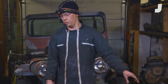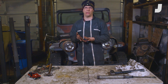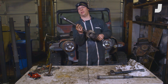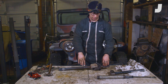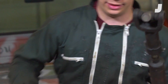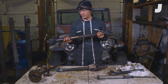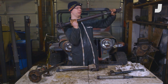Now we're going to move on to U-joints. Those CV style axles you see on all sorts of different kinds of passenger cars, but on heavier duty stuff, especially things with solid axles, you'll see U-joint axle shafts like this one here. It just has a single pivot and that's because it sits inside of an axle. That axle moves up and down, so all this has to do is comply when you turn your wheel left and right. It receives power from a drive shaft, and when that axle moves up and down, the drive shaft between the transmission or transfer case and the axle will stretch and retract along some splines in here — so this takes up the up and down motion of the axle.